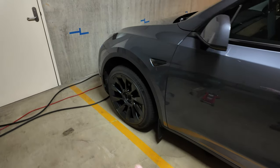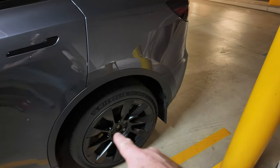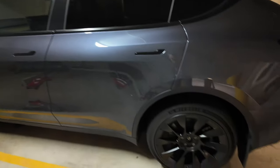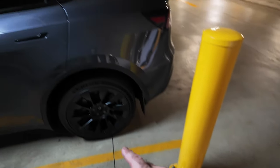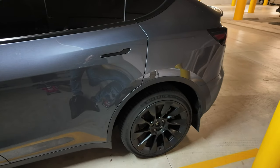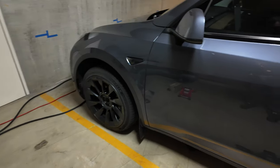My wheels are back on, the lug nuts are torqued up to 129 foot pounds, 175 Newton meters. What I'd like to do is take the car for a drive around the block, come back, and then re-tension them with the torque wrench again just to be sure — in case for some reason the weight wasn't evenly on the wheels. It's just a habit I always like to double-check the wheels after taking it for a drive.